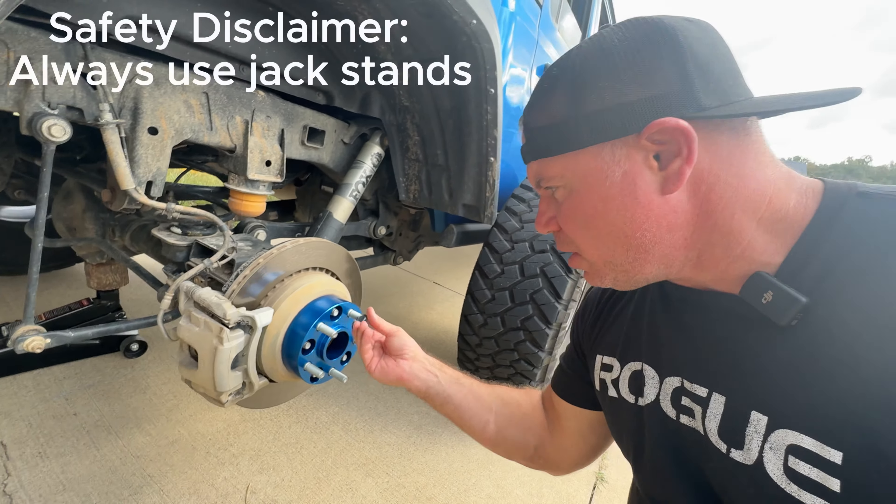I'm not talking about death wobble - I'm talking about when you're driving and you're a little lackadaisical on your attention span and the Jeep wants to veer left or right on the interstate or a two-lane highway at higher speeds. These vehicles are not known for their stability and control on the road - not like a BMW or a nicer sports car with a finely tuned suspension. These are very loose and they get looser as they get older, and eventually you develop a death wobble. Death wobble has nothing to do with a steering stabilizer - it's all to do with wear and tear on joints, bolts, and everything connected.